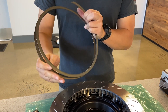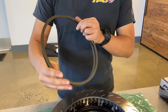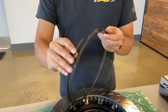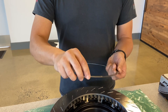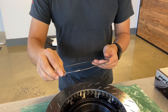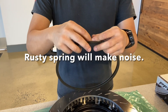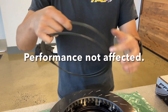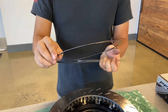Occasionally, if the car is washed and there's a lot of brake dust, the water will turn brake dust into rust. It could lock this spring if the car is not driven for the wheels to spin and repel the water out. For instance, if someone washes their car and immediately parks it for three months, it's very likely that rust will develop. In such a case, we would just wipe the rust off and take some WD-40 and lightly go around it to lubricate it, get rid of the rust, and we're back in business.